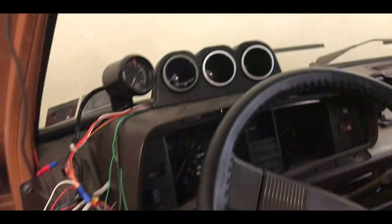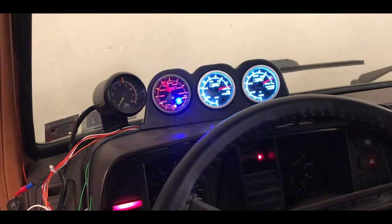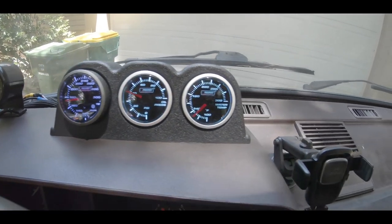Lots of other maintenance things: air filter, fuel pump, fuel filter, oil filter. This time I put in an oil pressure gauge and oil temperature gauge using a sandwich adapter, and I ended up needing a smaller oil filter so it could fit with the exhaust nearby. Now I have three extra gauges and it's been fantastic having those numbers. I know I can't become glued to the numbers — none of these gauges are really going to be that accurate — but I'd like to use them to understand how the engine and systems behave, watching for patterns rather than specific numbers.